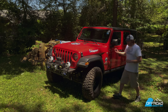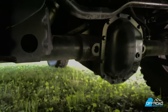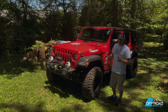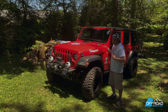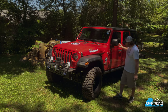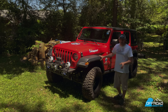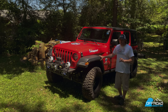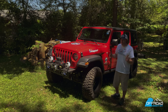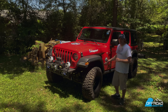The rear axle is different on this particular Jeep. This rear axle is kind of a Dana 44, but it's actually the M220. Regular Sports will come with the M200 — this is an M220. It's an anti-spin differential, and it was part of the tow package that came with this Jeep. So that's another thing you've got to look at — what type of axle is in the back. The M200 is comparable to a Dana 35, and this one's going to be the M220.